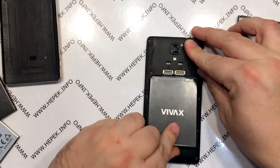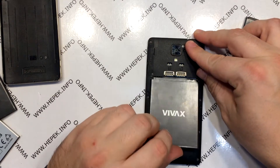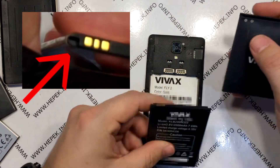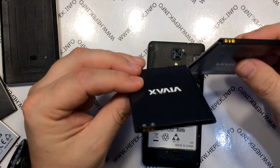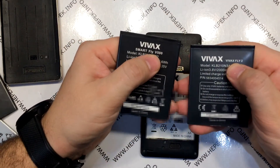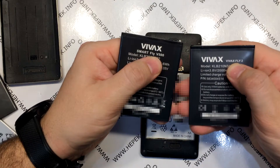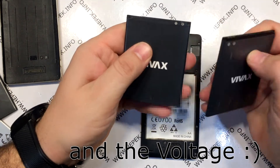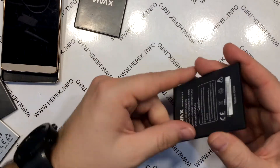I compare the next battery and as you can see by the width it fits into the device. In length it cannot fully be inserted. This is because of the upper plastic on the battery that has certain mechanisms that block it from going in — a protection mechanism to prevent people from putting any battery into any smartphone. But that will not be a problem for us; I will show you later in this video. The batteries are of two different models — don't let the battery model bother you, and even the manufacturer, as long as the battery physically fits. In this case the position of plus and minus is not on the same side, as are the battery contacts.